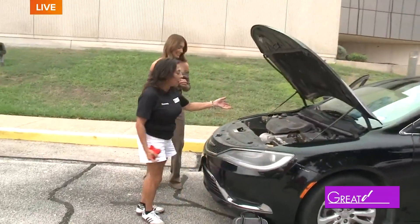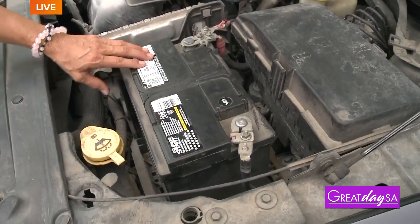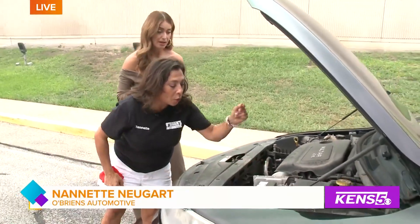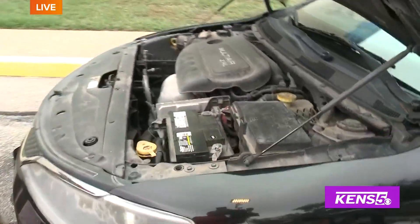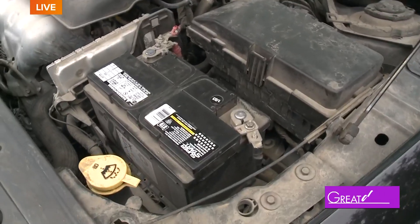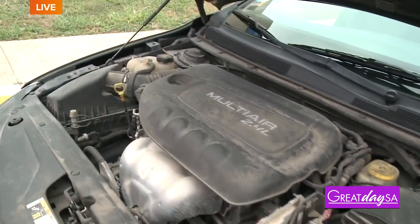Second, let's make sure we have a good, clean, running battery. First of all, make sure there is no acid coming out and the battery is not swollen. We want to take it somewhere and get it checked. A battery can actually get swollen — it just looks bigger — and if it's swollen in this heat, it's on its way out. You need to have them check that as well as your charging system and your alternator.